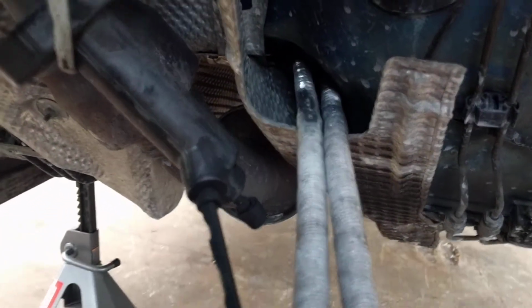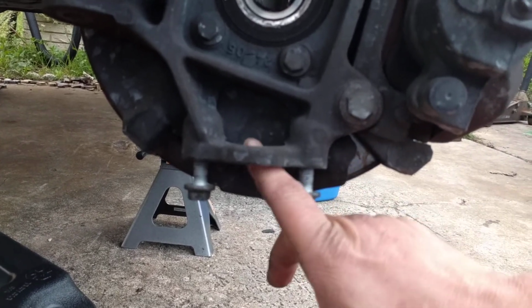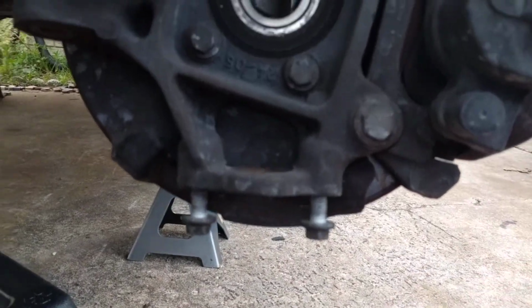And if you're ever wondering where the cables for the shifter go, right up here under the heat shield, huge pain in the ass to get to. Likewise, the whole subframe bolts under here. And here's the easy way to get the ball joints out. You don't actually have to bang them out and break the taper. They just bolt to the bottom of the control arm, so you just unbolt them when you're putting it in service position. And I love the service position euphemism here.